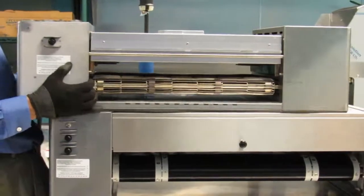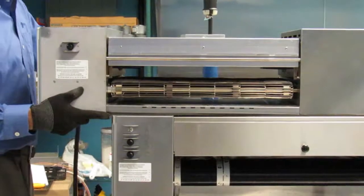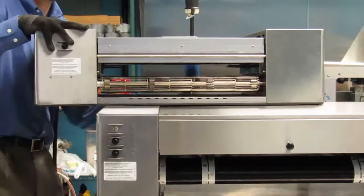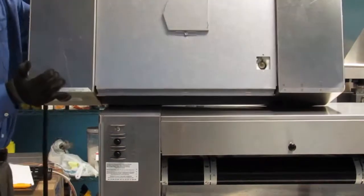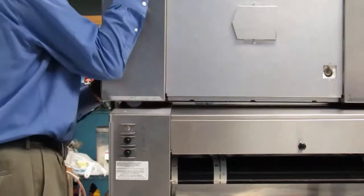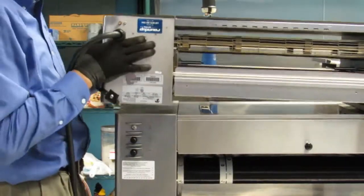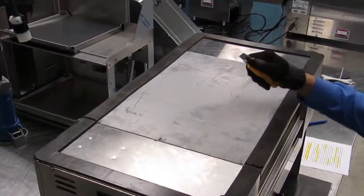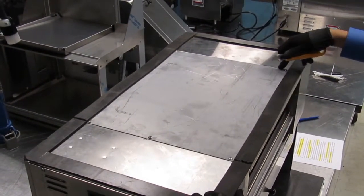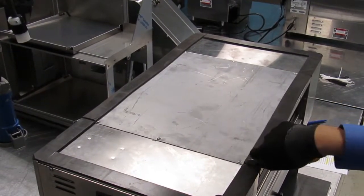Slide it 6 inches and approximately 10 inches towards the back. Lift the unit over. Take a utility knife and cut the gasket near the galvanized panel and the stainless steel at all four corners.